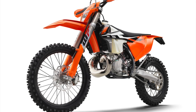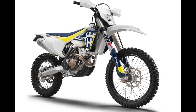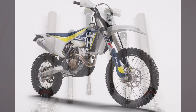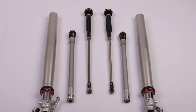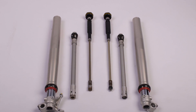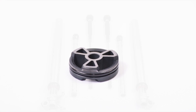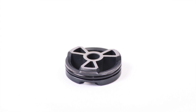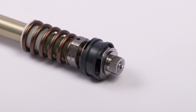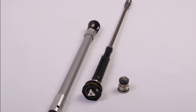Explorer comes standard on the 2017 KTM XCW 6 Days and Husqvarna FE models. Like the open cartridge fork it replaces, Explorer has a 12 millimeter damper rod, 23 millimeter cartridge tube, and a 28 millimeter base valve. Explorer also uses the same three-port base valve pistons and has the same mid-valve piston on the right fork leg. Both forks use unsealed, unpressurized cartridges.